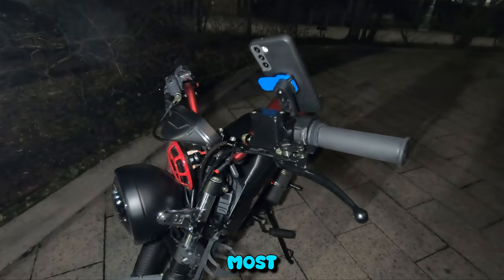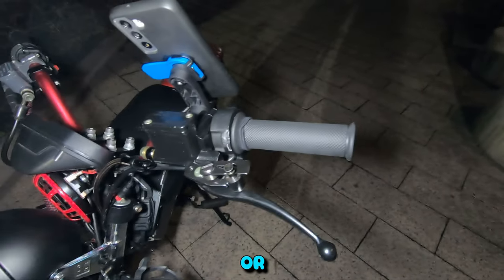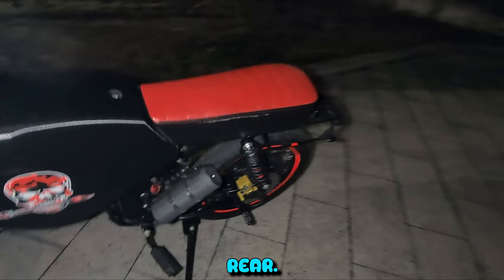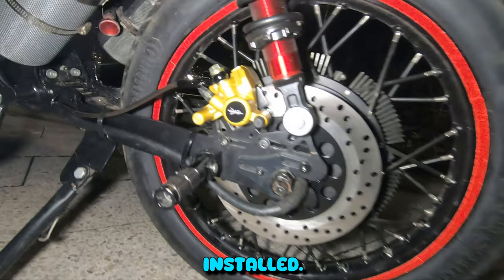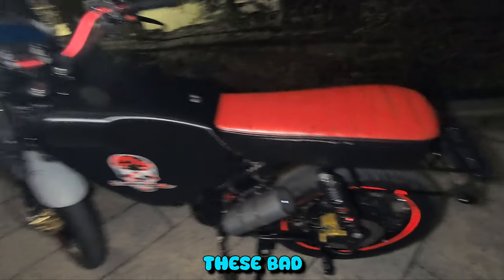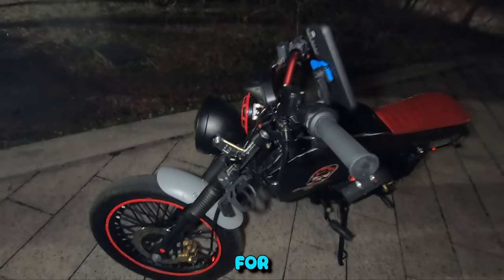There's another thing right here that most people don't have just yet — motorcycle brakes for the rear. I hear everybody complaining about their Magura not biting enough or their cheap stock Onyx brakes not biting enough. Well, we have motorcycle brakes for the rear. I'm actually the first person to have them installed on their bike. They're from Dat Shop, they're not out yet — I'm doing some testing for Alvin at Dat Shop. These bad boys are going to have some crazy braking power. Right now we're testing the master cylinder, and I'll have a review video once they drop.